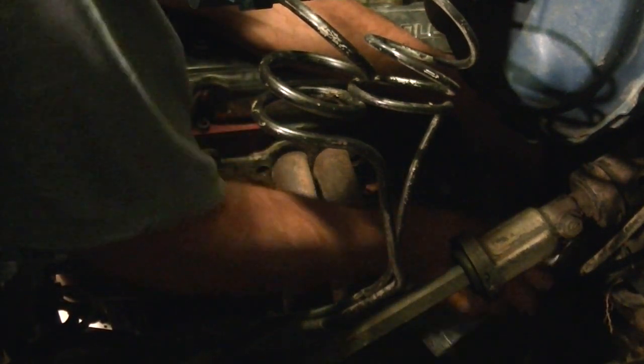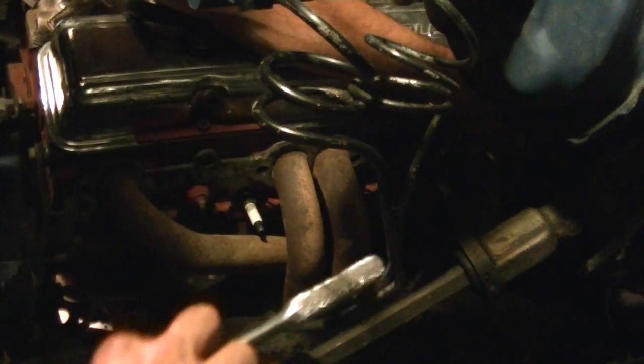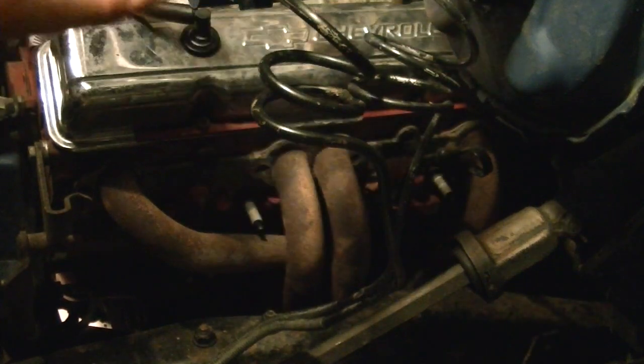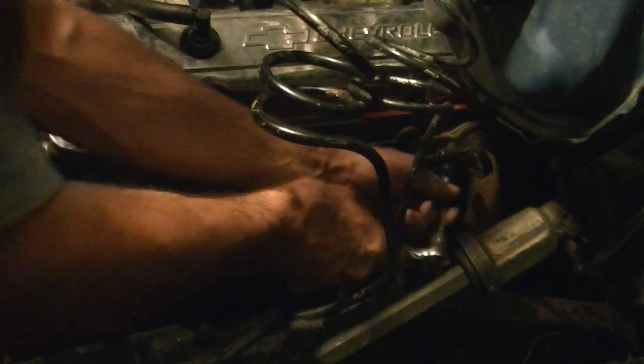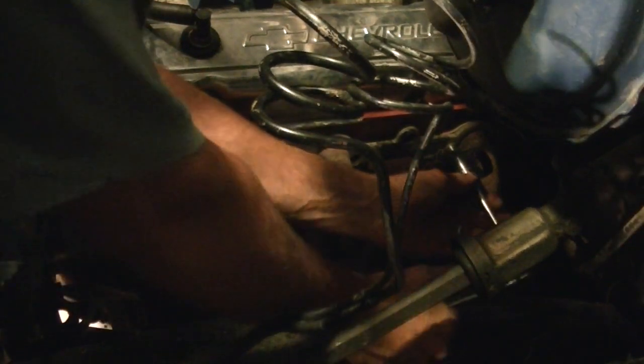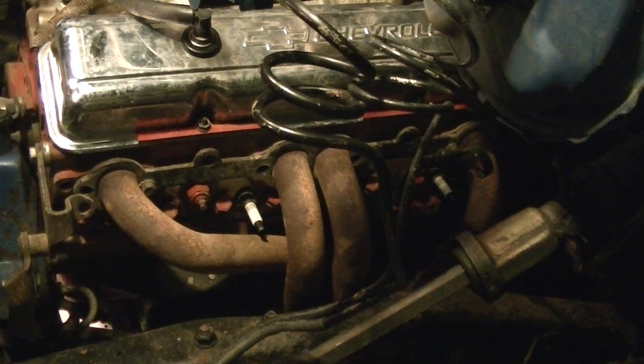I have to run a die over this bolt, tapping the hole with this little carbon on it. Gasket must be leaking back here. Or mud. Always break that back bolt loose, but I don't loosen it. Just give it about a quarter turn.